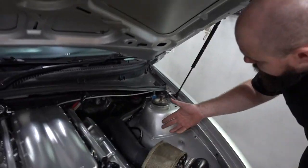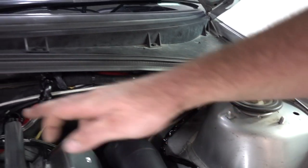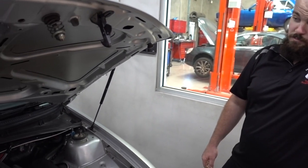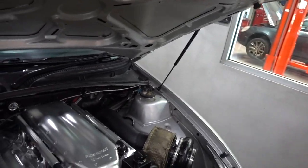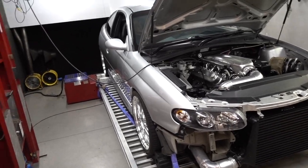So that's about what I'd expect from a 14-pound setup. What I've done now is hooked up the boost controller, wired into the Haltech, still running off the manifold. Hopefully we can put a little bit more boost through it and make a bit more power. On about 8.5 pounds there we made about 425–430 kilowatts. Timing is still pretty conservative, but we'd rather put a bit more boost in than too much timing.